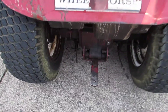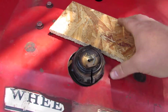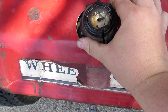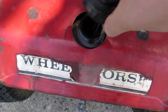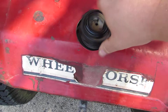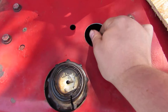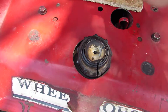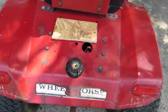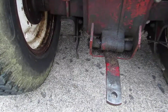It's got a hitch on the back here. Open this up - there's your fuel tank; it's got a cork on the filler, which is kind of cool because it shows you the level. I think it's about a three-gallon tank. Here's your fluid reservoir for your hydro - in the owner's manual it says you can run 10W30 oil in it, but it's actually got ATF fluid in it, I think it's Wolf's Head. I do have a slight leak there, which will be another project for another day.